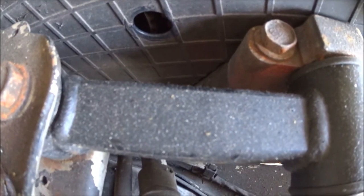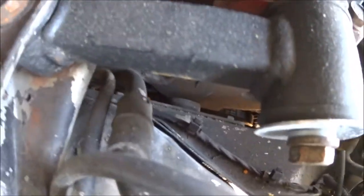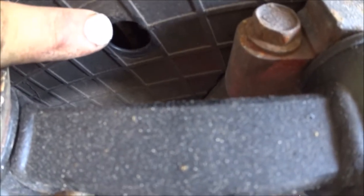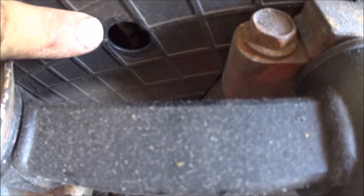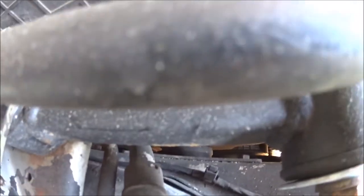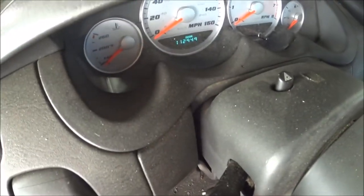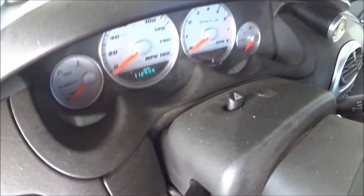What happened is it was sitting there idling, warming up first thing in the morning, just shut off and won't crank. We have one timing mark on this side but the other side isn't lined up, so we're assuming something's off. The car has 112,000 miles, and at that age and mileage you really want to do the timing belt around 100,000.